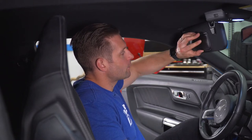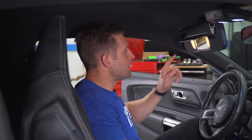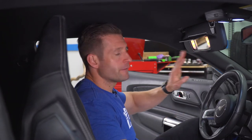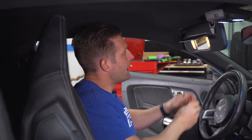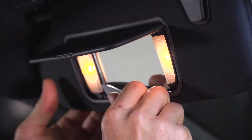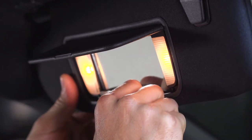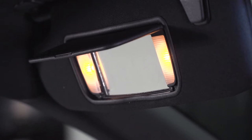Pretty simple to do — just drop it down, flip it open. Your lights are obviously behind these little lenses, so we need to remove these first, and then there are a couple screws behind there that you need to remove in order to drop the housing or the mirror assembly from the visor itself. At that point we can go ahead and remove the bulbs. So grab a small flathead, maybe a blade — we're gonna get behind these lenses first, pry it off, being careful not to cut yourself or damage the lens itself.